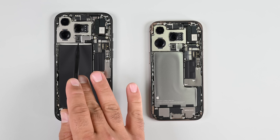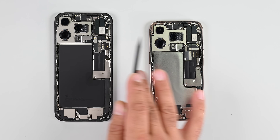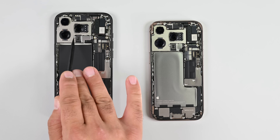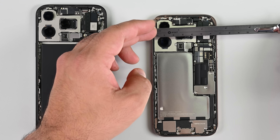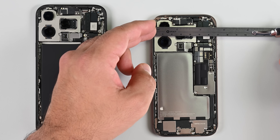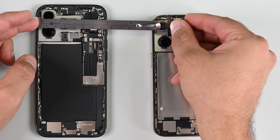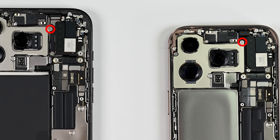Taking a quick tour of the components and looking for changes over last year's phones, we can see the LiDAR scanner is now immediately accessible instead of being buried under the main camera assembly. The camera modules also look to be interchangeable, housing the same hardware and having the same dimensions — were it not for one tiny change in screw orientation next to the Tetra Prism lens. The cables leading out from the cameras are also a different length, which is unfortunate.